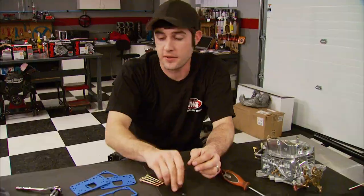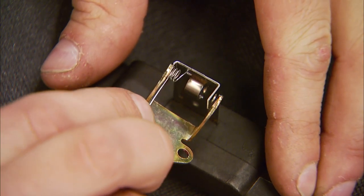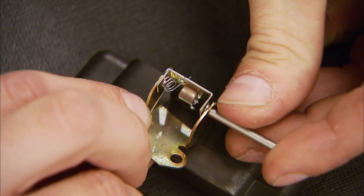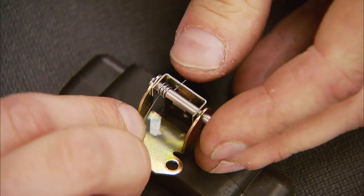Now this is the smallest piece of the whole swap, and also the trickiest. Attaching the hangers to the floats can be a big pain. You have to get this small spring positioned just right on the hanger and the float, then slide the pin through the assembly making sure the spring doesn't pop out of place. I did a lot of practice, but if you're lucky enough to get it on the first time, you better book a flight to Vegas.